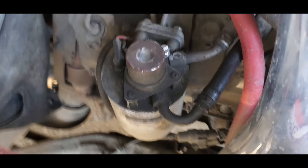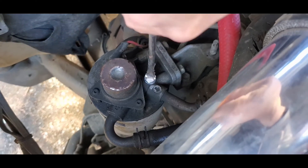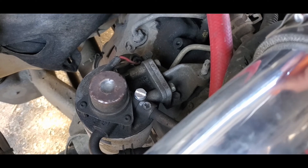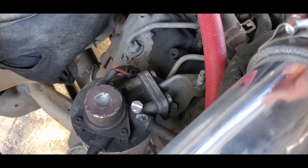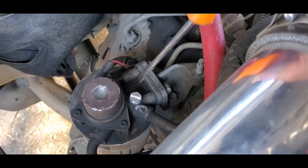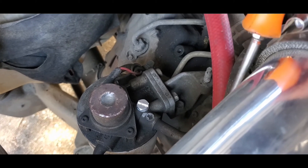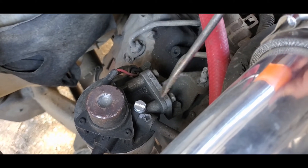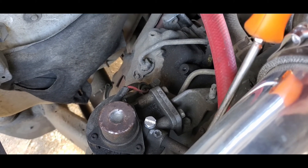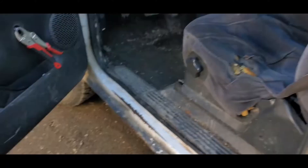There's the little screw right here. Now if you don't have a lift pump you probably want to bleed out any air that you may have got in there — although there might not be any air, might be just fine. I have a lift pump though, so I'm just going to turn that on, let it cycle out that air, then turn on the truck and we'll see if it leaks. This is probably good enough.